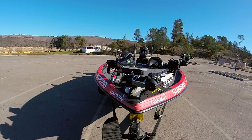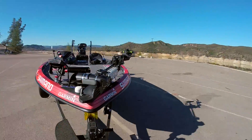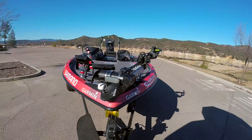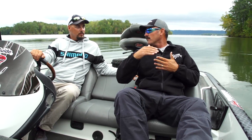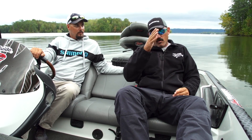When you finally do load your boat on the trailer, it's important to make sure that jack plate is lowered all the way. Because it's putting a lot of weight on a pivot point basically, and it really puts too much stress on those bolts — it's just not a good situation. So make sure you get that thing all the way buried, and you're good to go.